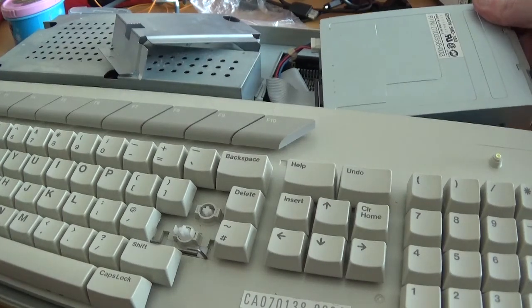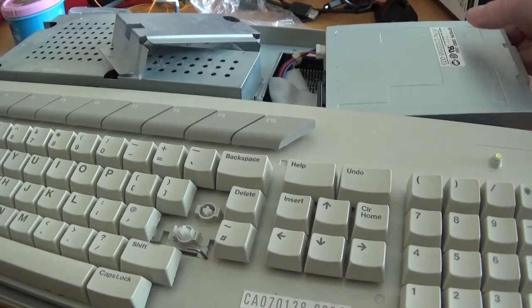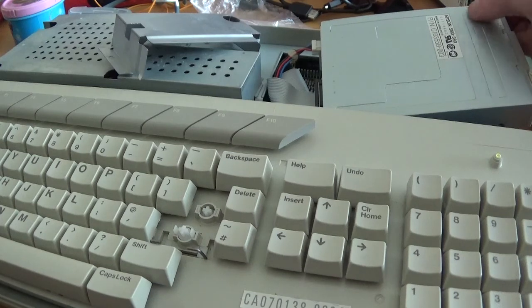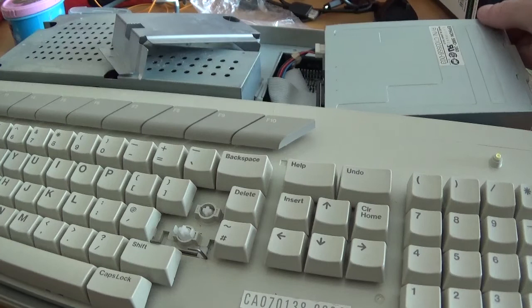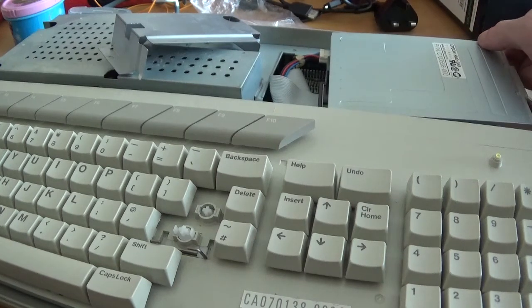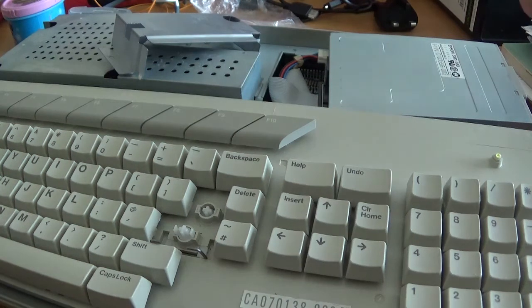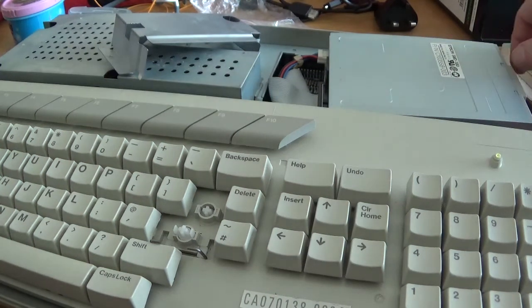So the STE, it looks like the majority of them either had the Epson SMD 380 drive that I've got, or a Sony variant. And I was looking at the symptoms, about what sounds they make when they're struggling to load, and what it'll tell you on the screen, etc. And I'm fairly certain it's the heads are completely knackered on this.